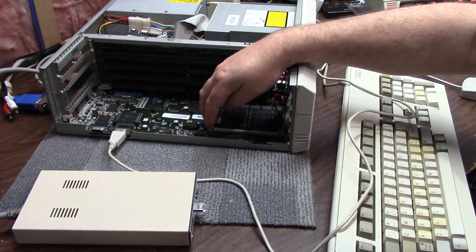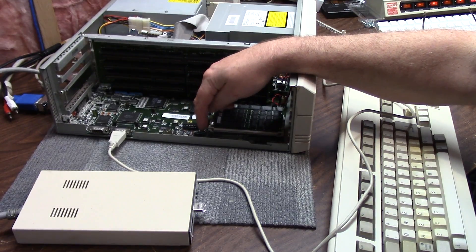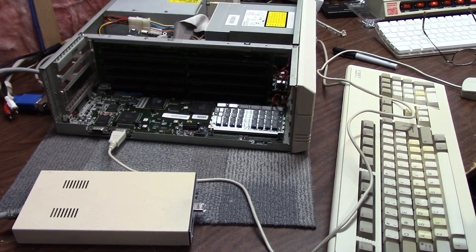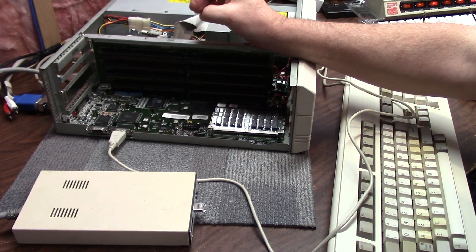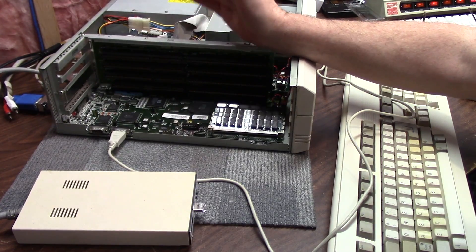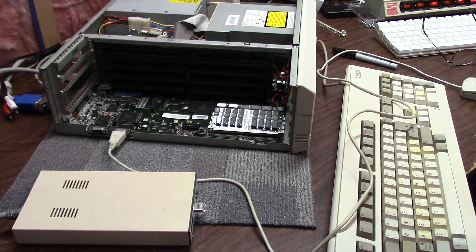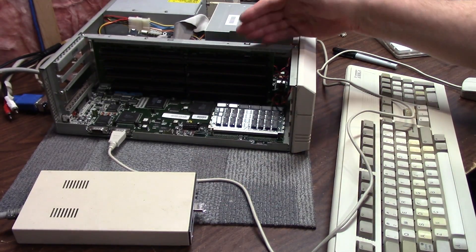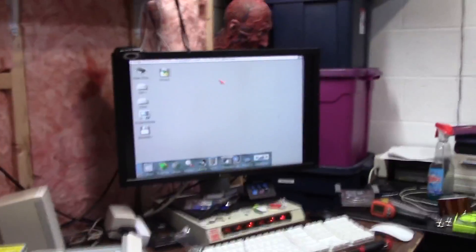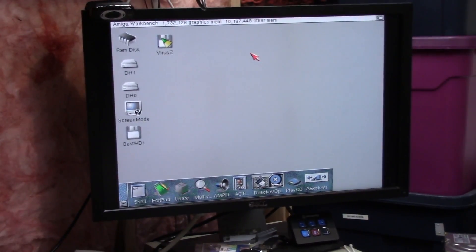They're a little bit not so high of a pitch. I still have to put my final SIMM socket on so I can put this one in. I also have to put the battery for the real-time clock back on — I ordered 10 of these from various dealers and we'll see who comes in first. That is about it right now. We are pretty much complete: a completely recapped and repaired Amiga 4000 with maximum RAM, CD-ROM, 3640, OS 3.9 on a 31 kilohertz signal with the DB23 to 15-pin VGA adapter.